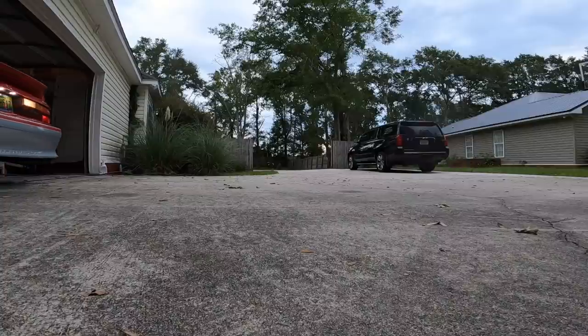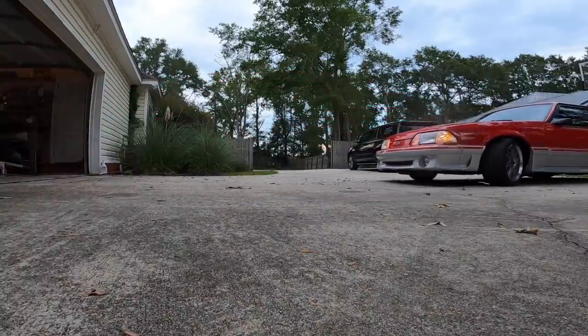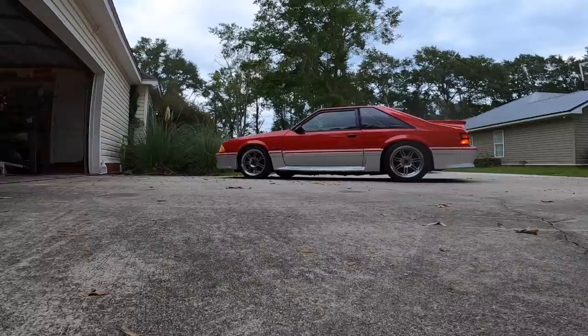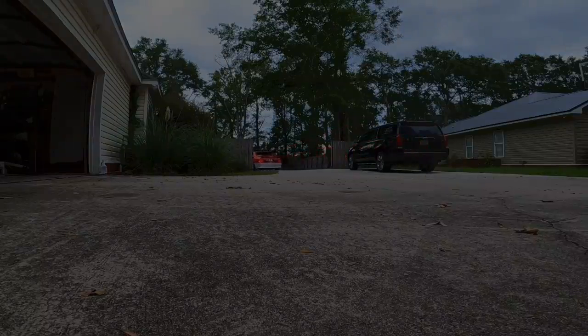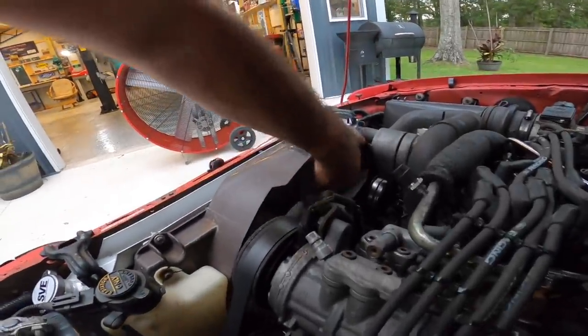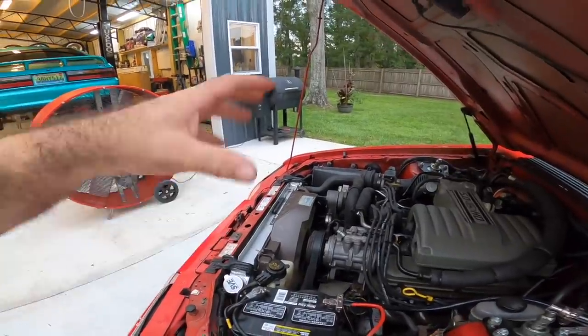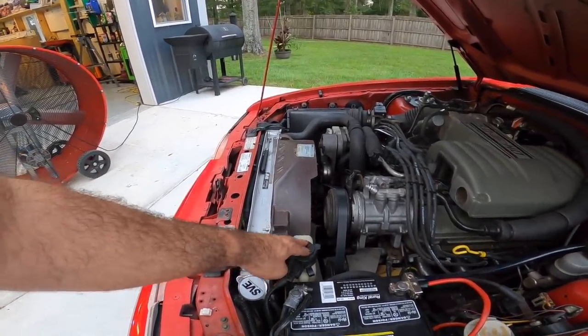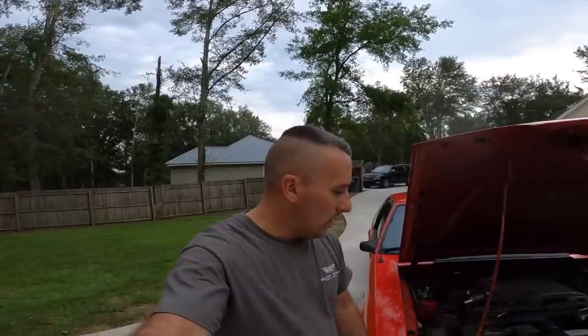Let's walk up here and look at the Retro Fox real quick because it's a little different — it's all stock underneath the hood. We have an actual clutch fan on that car, and you know what, that's not a bad thing. As you can see, this is a completely different setup. One of the things I want to talk about is these fans — they should have a little bit of tension on them. Check and make sure your fan isn't completely free spinning; make sure it's got some tension on it. Also, your overflow tank — make sure that it's operable and not busted, because this thing uses that tank as well. These are some of the different things you might run into if you're having cooling issues. I hope it helps somebody — thanks for watching.